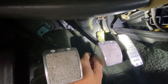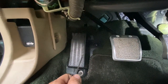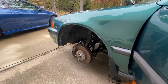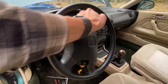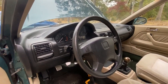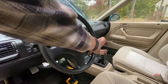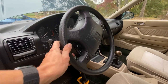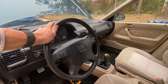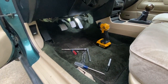Tightened up the two 10mm bolts connecting the steering rack to the column, put the plastic cover back in place with the metal clips, reinstalled the dead pedal with three 10mm bolts, and tucked the carpet back. Wheels are dead straight — let's test the steering. Full lock right, reset to center, and here's the true test: turning left — full lock, no sounds of any wire stretching. We are successful. However, I'm still not able to lock the steering wheel when the key's out — that's a small remaining issue. But I'm happy the wires aren't stretching. Steering column is resolved about 90% of the way.